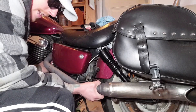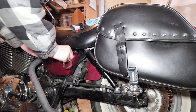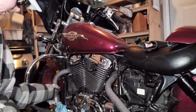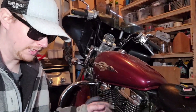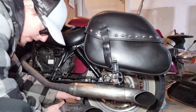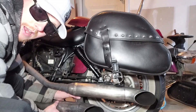I'm not going to put the gaskets on just yet — I'm going to be taking the exhaust back off. Alright, so I got the exhaust back on. The hardest part is knowing if there's a leak anywhere in here or up behind the front one without actually starting the bike. I do have the gaskets to go in. The reason I put it on is because when I took it off, the bracket down here — I had to put a couple of washers in between. Hopefully I can adjust them up so I don't have to have them in there.